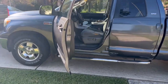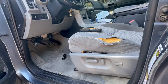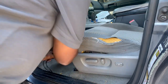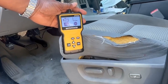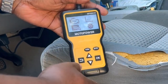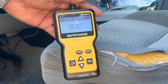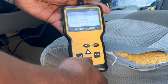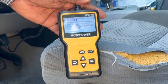Let's check my 2007 Tundra. I know what's wrong with it — when my catalytic converter got stolen, they cut my oxygen sensors. I got the catalytic converter replaced, but as you can see, that check engine light is still on because the computer module is messed up. I think it shorted something out when they cut the sensors and shorted out my O2 sensors in the computer. I'm going to have to get the computer changed. If I plug this up, make sure it's turned on, go up, hit OBD, and hit OK — it's going to run the scan. I took this to AutoZone and it had this same code. I even took it to the Toyota dealership and it had the same code. So this thing works really well. We're going to hit read code. As you can see, P0157 — it says oxygen sensor.